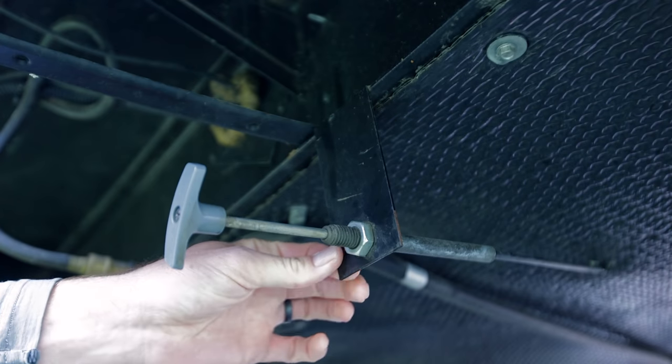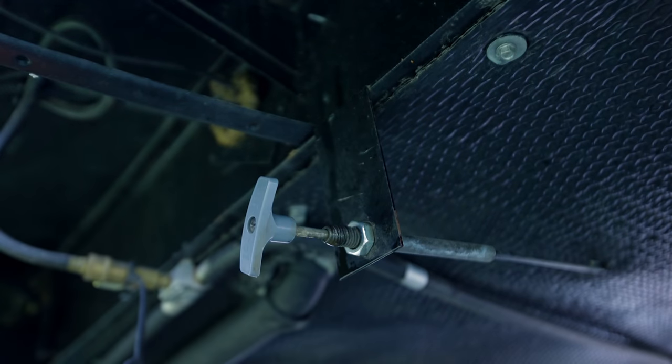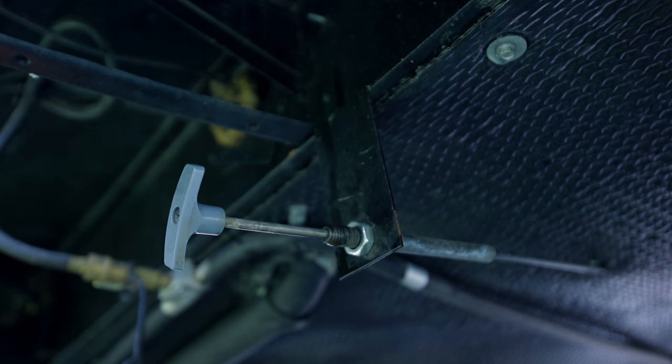Find those weak points in your RV. For instance, we have our galley tank connected to a very thin piece of metal that's connected to the frame, and you pull that handle to allow that tank to open so we can drain it, then close it. You're basically taking that piece of metal and flexing it a little bit every time. So what I do — knowing that is a weak point — is when I'm closing that valve I'll put my hand behind it, or I'll squeeze the handle and that piece of metal so I'm not putting stress against that joint. When I'm opening it I'll grab it with my hand and pull the handle — anything I can do to not create that flexing motion to cause a break in the metal.